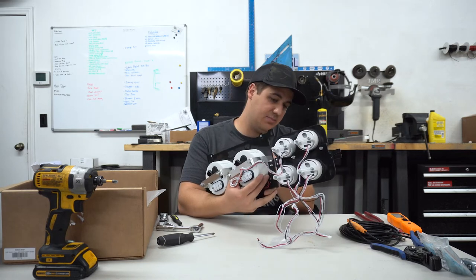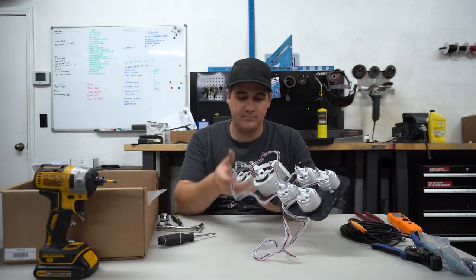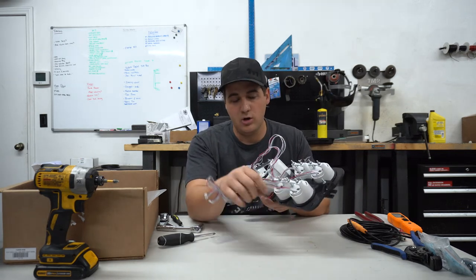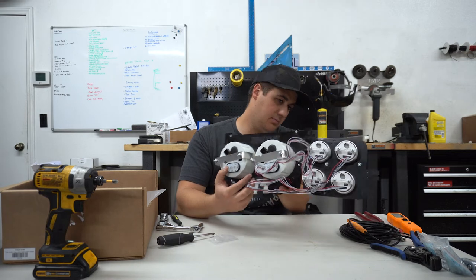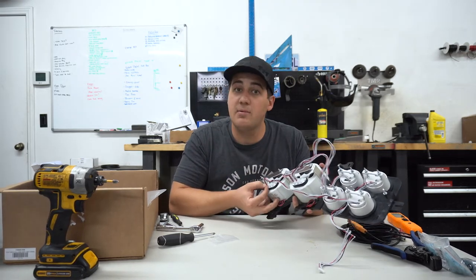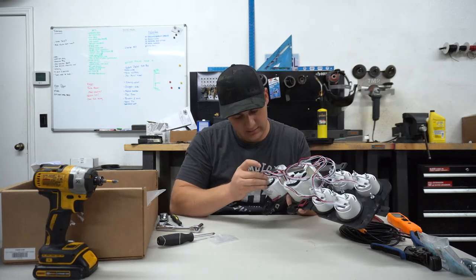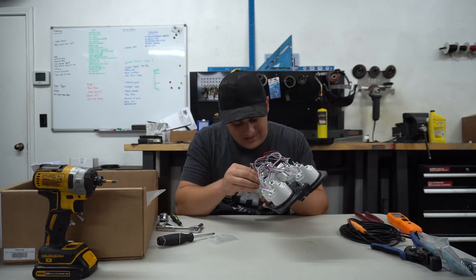When you're done, you could zip tie these wires up, bunch them up neatly so they're out of the way when you're installing this in your truck. Next, over to your voltmeter and your oil pressure gauge — your voltmeter is going to go to letter B on the tachometer side. Our voltmeter here is our bottom right, so we'll come all the way over here to B. They measured that out perfectly so you don't have a ton of wire hanging around. And then our oil pressure sender is going to go to letter D. Just like that. Make sure everything's pushed in nice and tight and everything's good before you go putting this in your truck.